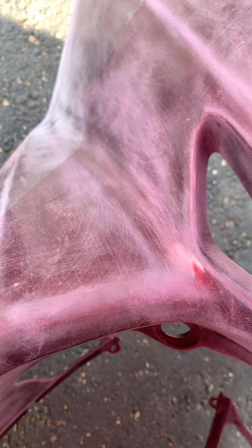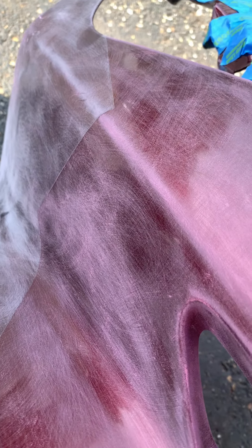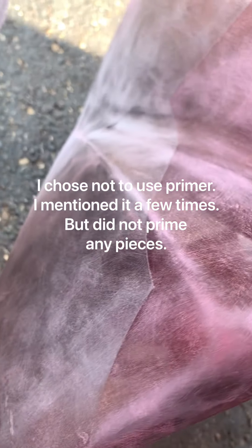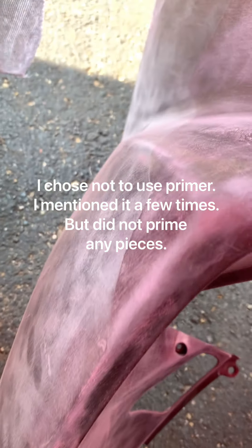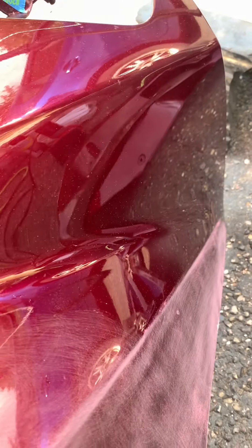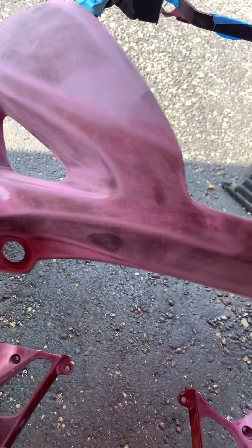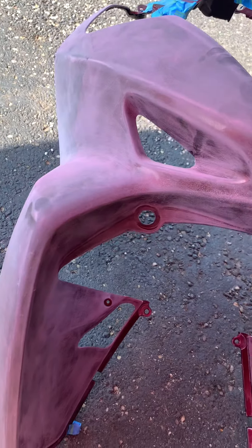I hate sanding, but I'm scuffing it up with the pad. Not really worried about the typical spray painting pattern — I just wanted to scuff it up so it'll adhere and grab the primer and the Raptor bed liner spray. This is what it looks like — scary looking to me, but I want it to adhere and have places to bond to the plastic.